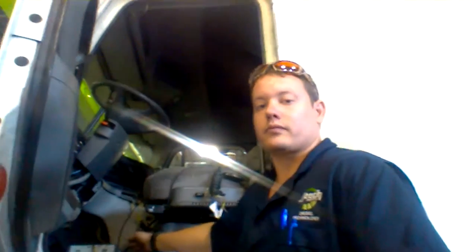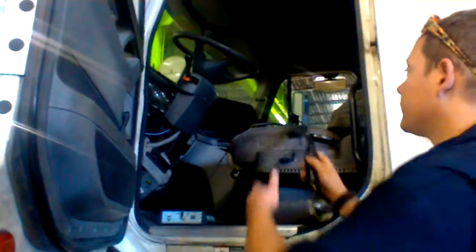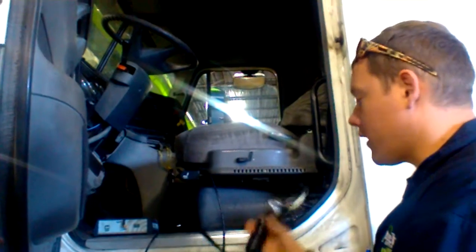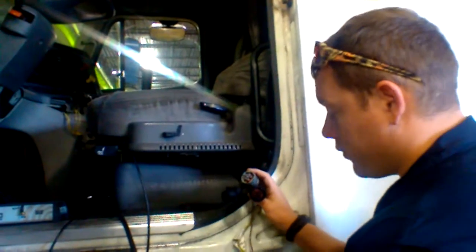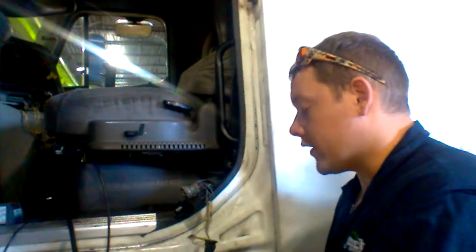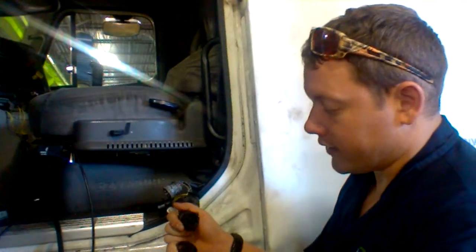Next, I'm going to show you how to hook it up. You've got this cable right here that hooks up into your 12-volt power system in your semi to give the scan tool its actual power. Next you've got your actual link that goes from the back of your scan tool to another link into your wiring harness. This truck has many different points of contact to use — I use this one, it's a 12-point — and you literally just match them up and twist.